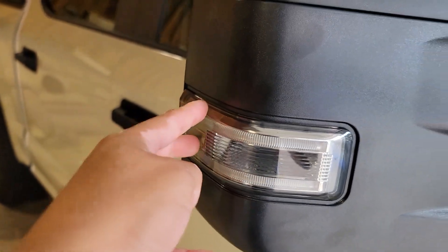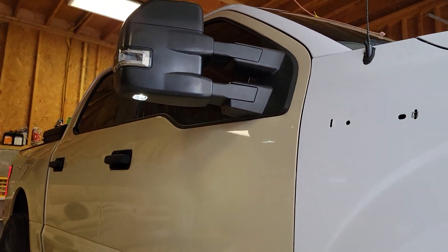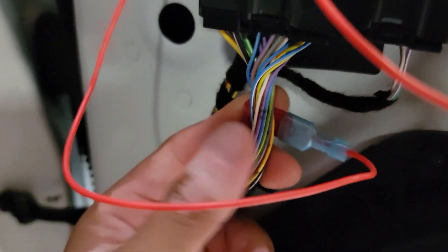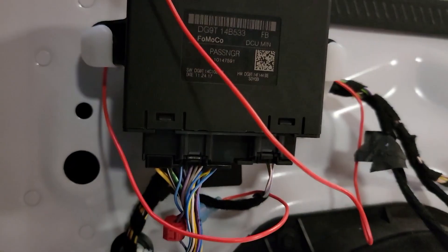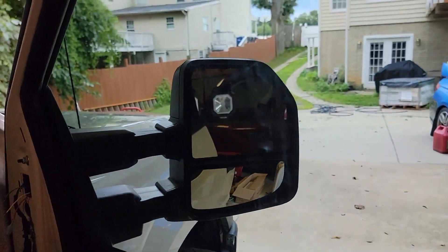You can see the little directional arrow over here for the turn signals, puddle lights, a spotlight, and then two strips that are supposed to light up. I wired up the puddle light — I believe this is the spot, this is the auxiliary light, and the red one is the puddle light. I tapped into the gray with violet — that purple and gray cable. The other option is to run the cable through the grommet and fish it through to one of the main wiring harnesses, but I just tapped it from the junction box.